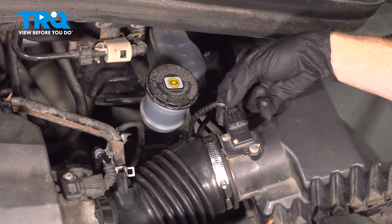Now that we've disconnected the mass airflow sensor, let's start loosening the clamp that's holding the air inlet tube to the upper air filter housing. On my application, I'll be using a 10 millimeter here. You don't need to fully remove it — just loosen it up enough that you can slide this off of the upper air filter box. Now we'll start dislodging the upper air filter box from the lower air filter box. This is held in place with four 8-millimeter-headed mounting bolts, one in each corner.